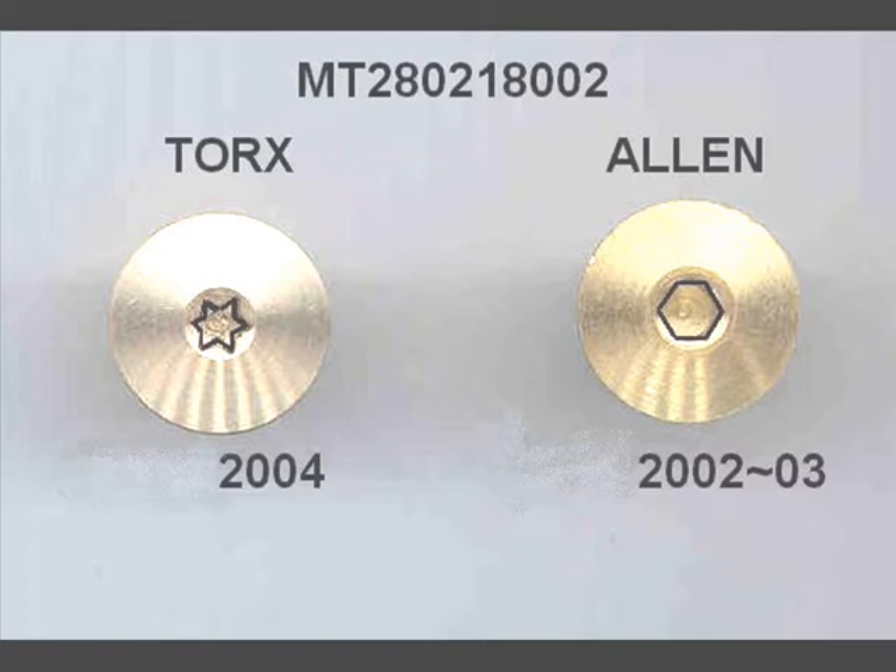In 2002 and 2003 this bronze water pump bushing was showing signs of premature wear. They decided to change the alloy, and to know the difference between the early model and the later improved version, they changed it from an Allen to a Torx head. Beginning in the 2004 model year this will remove with a Torx, not an Allen. If you have one with an Allen, or if you see one offered as a replacement part that uses an Allen, do not accept that — that would be the inferior original design. The Torx ones are the improved version; other than that it's almost impossible to tell the difference because it's the alloy.